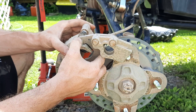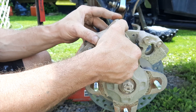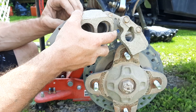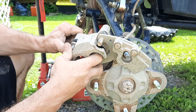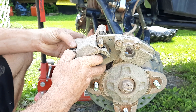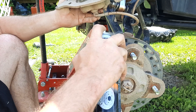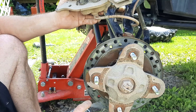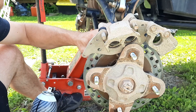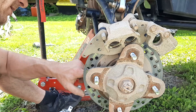Clean off these old sliders — they didn't look too bad, but over time dirt and mud will get in there and stop your brakes from working properly. We'll go ahead and lube these up. It doesn't take a lot of grease — just a little. You want to use silicone grease, not regular grease, because it's thicker and dirt won't stick to it as well. That's all you need — just a quick light lube — then start putting it back together.